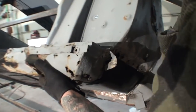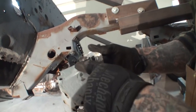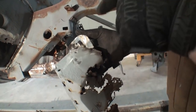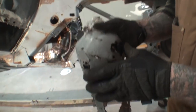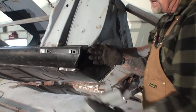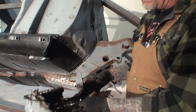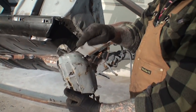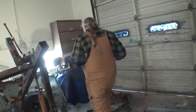So this was right here like this. If you look at this hole right here — that's this piece right here and they don't make this. So what I've got to do, I either got to make one — cut the spot welds out, flatten it out and make one — or we'll reuse this, which doesn't look like that's going to be a happy situation. So yeah, that's the cap on that. They actually have a separate cap, and instead of selling this with the rocker panel, I don't understand why they didn't do that. You've got to make that because it is obsolete. That's why I actually kept this, so I can make a pattern of this cap right here. You don't want to throw anything away until you're completely done with the job, because you might need it.